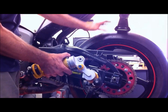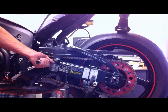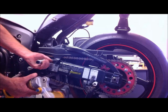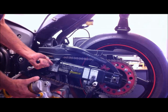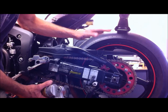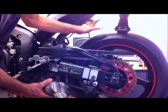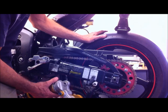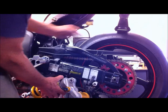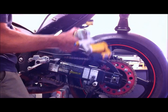Using this method with the car jack compared to having stands under your foot pegs — if you have support under your foot pegs you've got to jiggle and muck around with the back wheel to get it all lined up to get the bolts back through. But doing it this way is a lot easier and probably safer. Hopefully this will be quick.